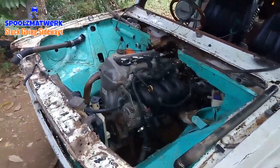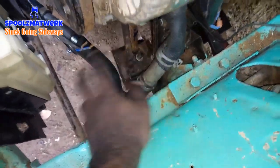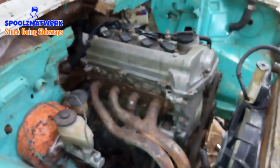Right now I'm dealing with the hose and pipe. I got some pipe out and I hose them with the 1NZ. I cut them up and used some pipe as extension to extend it to the radiator. I used the triple core radiator from the Lada so I don't have the overheating problem - triple core cools good. I have a draw-through fan and a push-through fan, so I don't have any overheating at all.